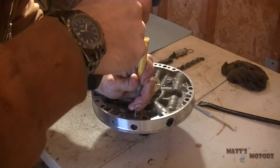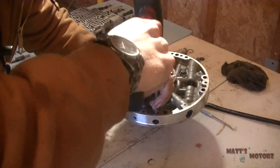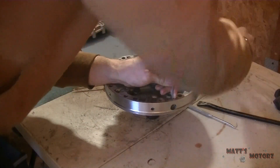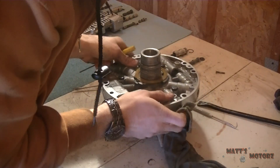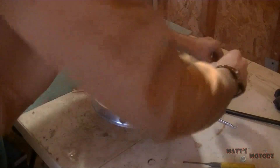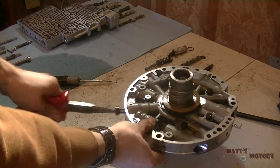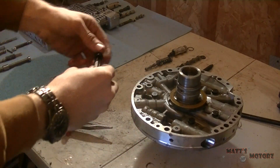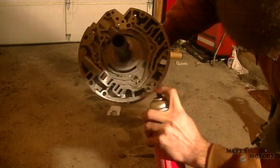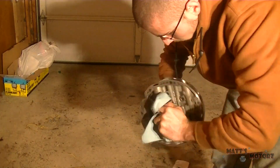This one I had to hammer out a pin. The spring is very strong, so be careful when you're working here because it can go flying out — put a rag or something over it so it doesn't do that. Taking out the filter — looks new again because this has been rebuilt before. Now we're going to clean the pump in the same way as the valve body, spraying it very clean.